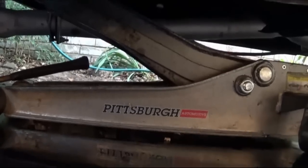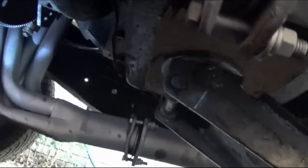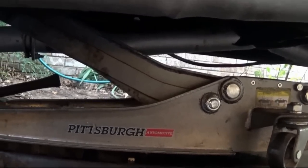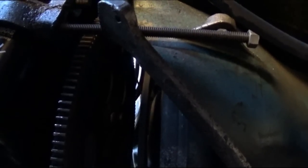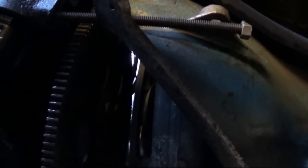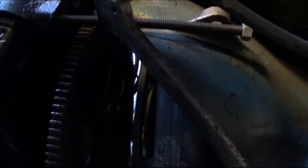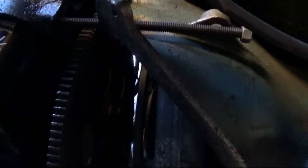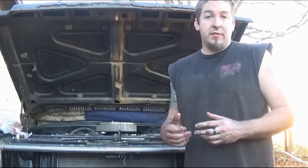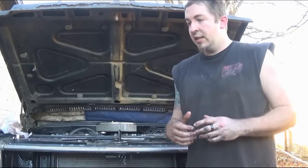For those of you doing this on the ground like me, our setup here uses a jack with a piece of wood to protect the transmission pan, and we're rolling it around on a piece of laminated wood so it rolls really easy — you can just slide it back and forth, which makes moving the transmission so much easier. As you can see, we have our all-thread going to the block through the transmission. Now we can get to our flex plate bolts and change the flex plate. When we slide the transmission back up, that all-thread will keep it lined up.